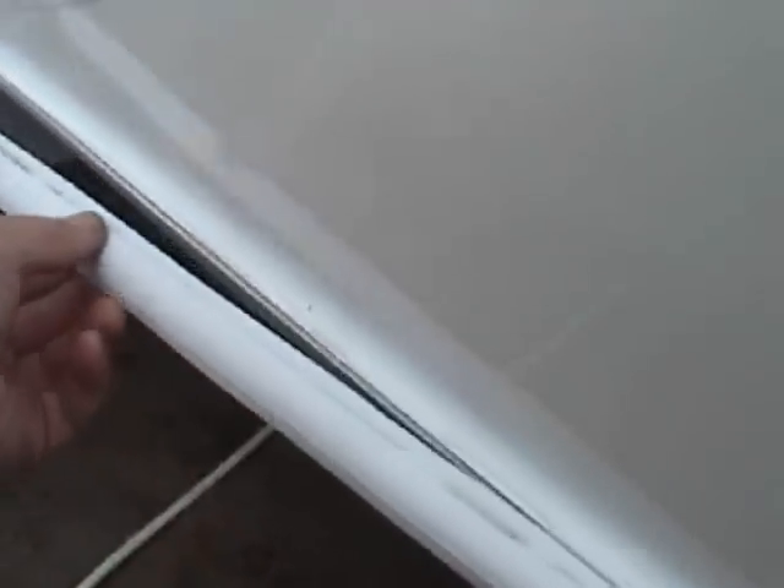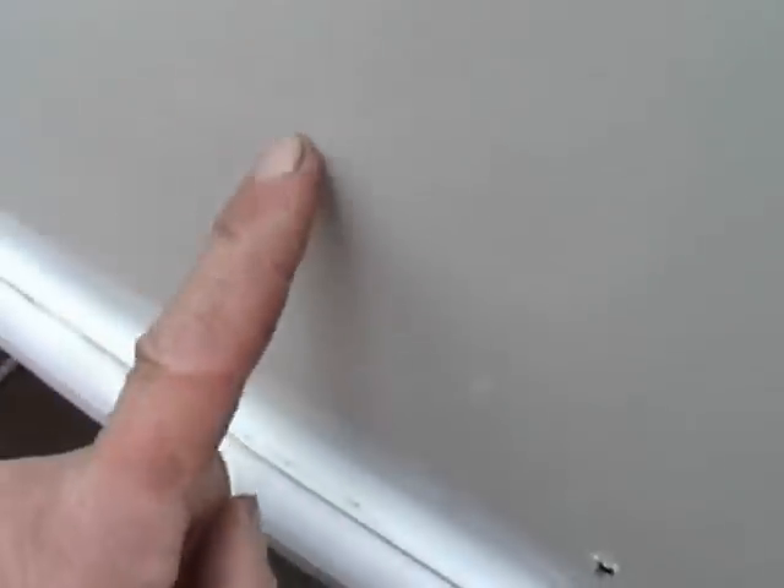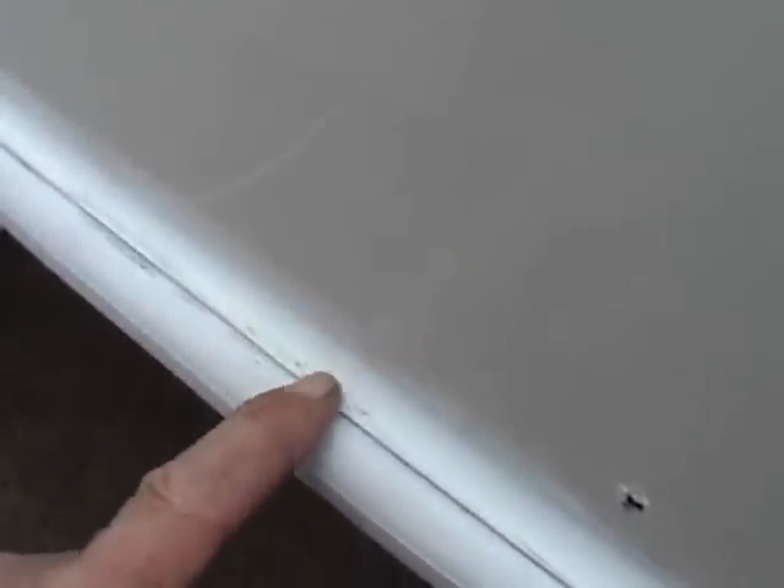As you can see, the washers are still bright due to my little modification. This is another mod I've done to create a drip stop so the water can't get onto the underside of the floor. This is a piece of plastic I've acquired that's that shape and it just pushes in like so. The cutouts are for strength — it's on the back of the fairing — so any water now runs down the front, hits here, can't go inside, comes to the end and just drops off onto the floor, as opposed to possibly going underneath to cause damp on the underside.